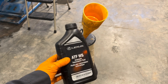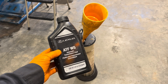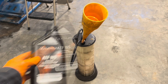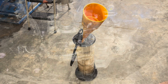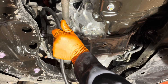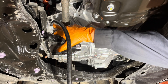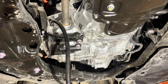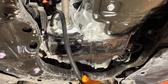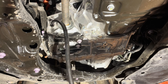You'll need four quarts of transmission fluid. I personally only use the Lexus/Toyota WS transmission fluid — I don't want to mess around with anything aftermarket. Transmission fluid is pretty inexpensive, and you'll also need a pump of some sort. Check for links below the video for the pump used at the shop. Get your pump and start pumping — fill it nice and steady until it starts overflowing out of the fill hole. The spec is between zero and 10 millimeters, about three-eighths of an inch below the hole, but I always fill it until it's full. Don't pump too fast or it'll shoot back out of the hole and spill everywhere, so take it easy and have a drain pan underneath.